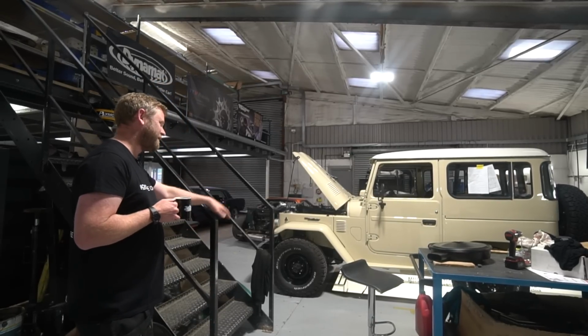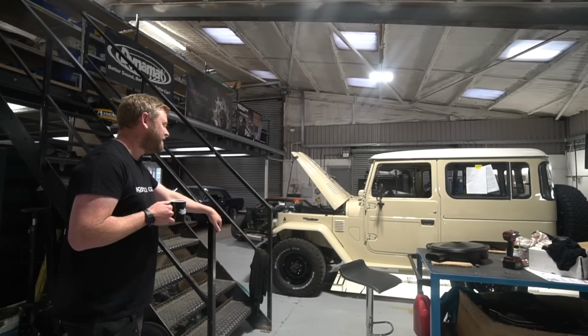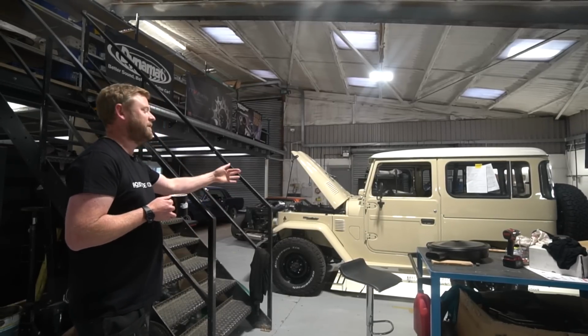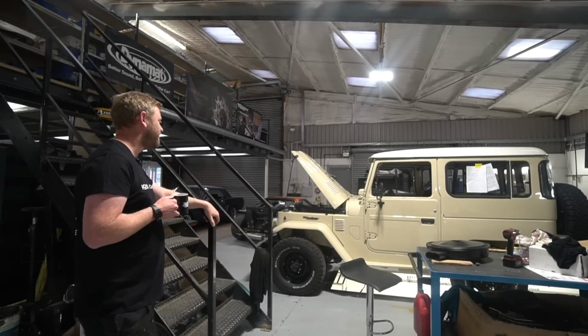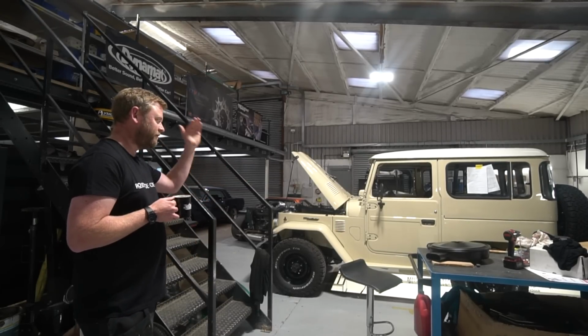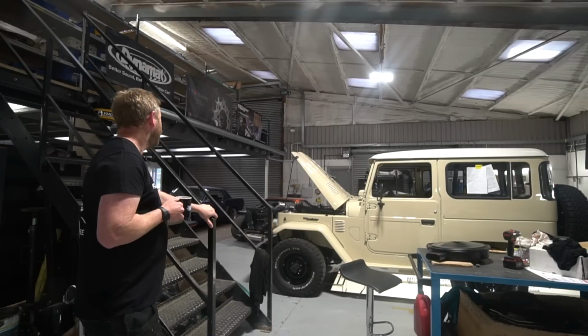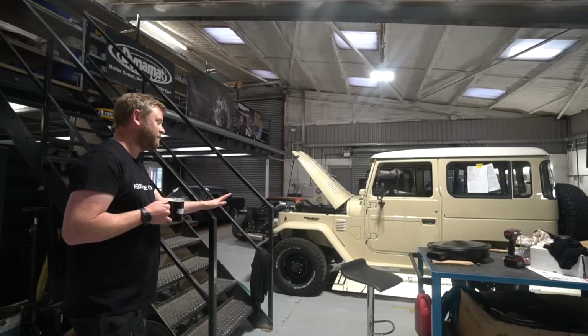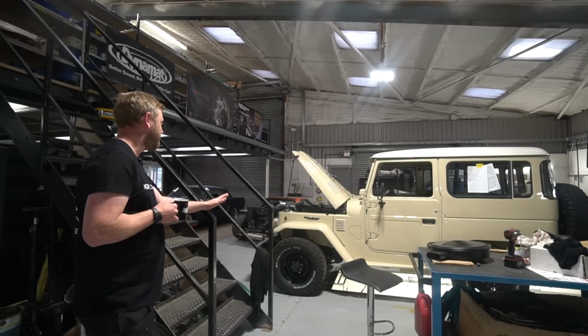They've also been all over this doing the final spanner check on it. We have a sheet that's ticked off with all the safety critical fasteners, everything's paint marked and photographed, and the photograph's uploaded to a build profile that goes with the car. So that's where we're at with that. Pretty much just waiting on the Viton lined fuel hose, and then we'll be into final testing.